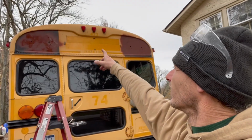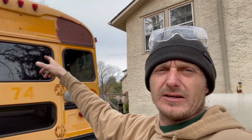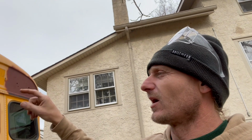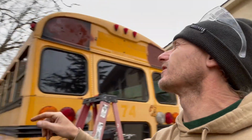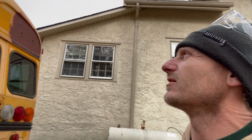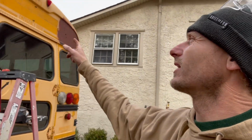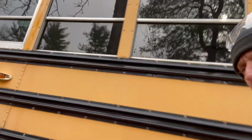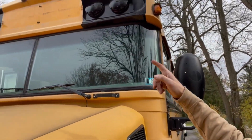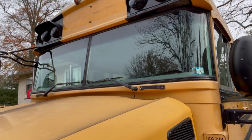Lights taken off, lids taken off, bolts grinded out because they were fully rusted in. Then I hit it with the refinisher metal brush, and now I have primer up there on the bus as well as primer on the plates that are going to be mounted up there, so it's just not going to rust or anything like that. And then I'm going to use silicone in between the plates and the bus. So waiting for all the primer to dry, and then I gotta do all the same work I did to the back to the front of this beast, because I want to delete the back and the front ones. They're leaking a little, and I think it's gonna look really cool without them.